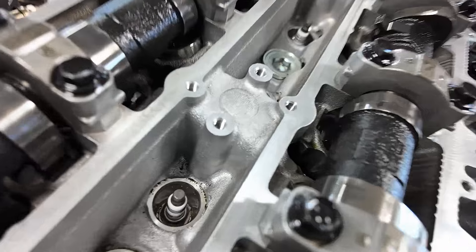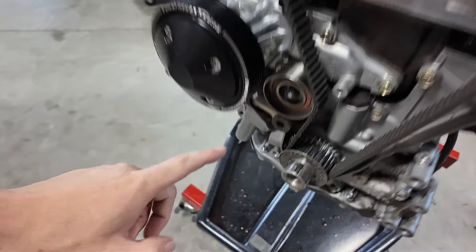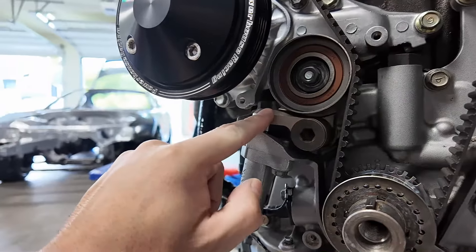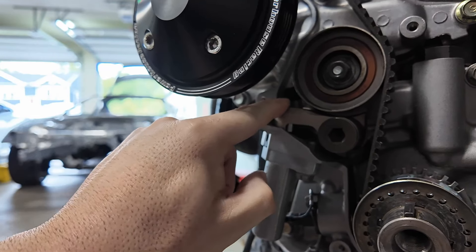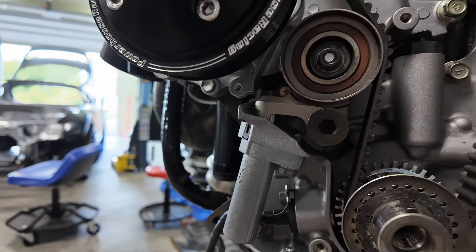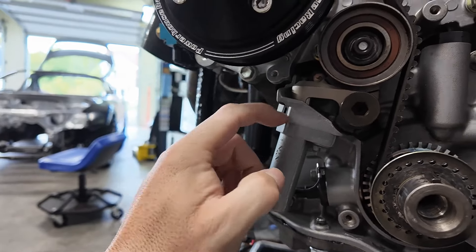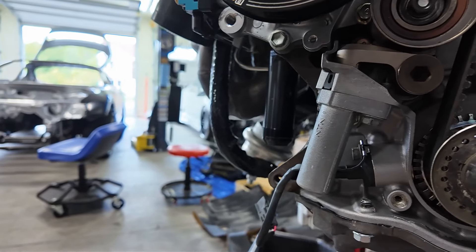Since the cams are off, everything in here - I do have to clean out the oil in there, cleaned off all the oil around this. I've got to take tension off it - there are two 12s here. I don't use titanium - use the factory bolts. I think there are alignment bolts too. This is an old-school piece - I might want to upgrade it just to be safe because I've heard of other parts from this company breaking. They were based out of Australia - they used to make the coolest looking parts, things like control arms. But they were one of the very first to use the brass bushing - everyone else just made a steel piece and they would seize up.